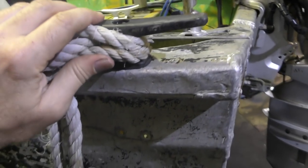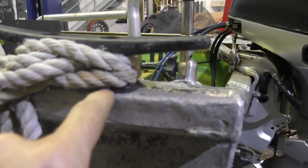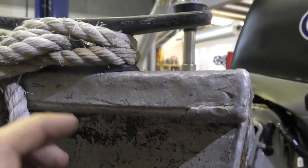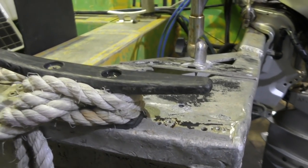I'd also decided to put some cleats on. So these are the types of cleats I've used in the past — I normally bolt them through and put a bit of a bed of Sikaflex underneath the cleat. Under here I've just got some nylock nuts because normal nuts will definitely vibrate loose. So stainless bolts, stainless nylocks, bit of Sikaflex. And look, it's pretty good.